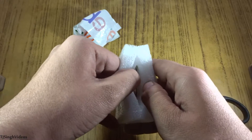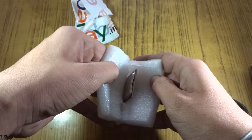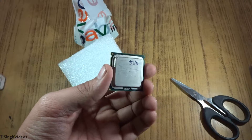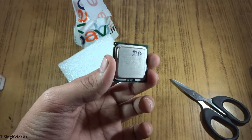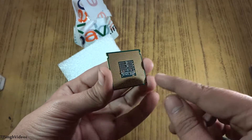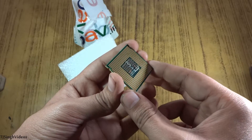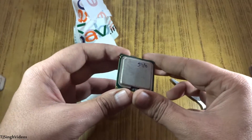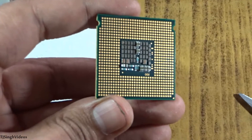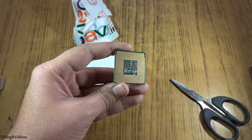So from here I'll open it up. This is our Intel Xeon processor. Its model number is Intel Xeon E5110 and it is an LGA771 socket processor. As you can see, we have the connectors that attach to the pins over the socket. It's in pretty good shape for a refurb unit. This is a 65 nanometer process chip, 65 watt maximum TDP, and it is a dual-core Intel Xeon processor.